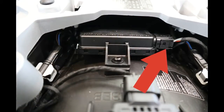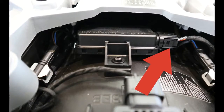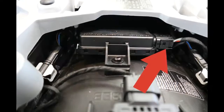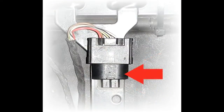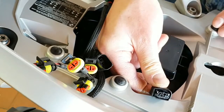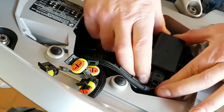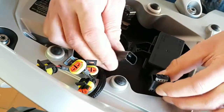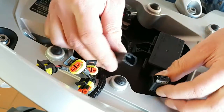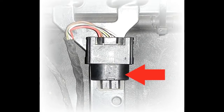If your liquid-cooled R1200 has an RDC system, you will see the RDC module in the small compartment just behind the rear seat and in front of the tail light. Note the wiring harness plug connected to the module. If your R1200 does not have an RDC system, the end of the wiring harness plug will be covered by a plastic blanking plug. Disconnect the wiring harness plug from the RDC module, or remove the plastic blanking plug. If you have an RDC system, connect the female EZ-Can CAN bus terminal to the RDC module, then connect the male EZ-Can CAN bus terminal to the motorcycle wiring harness plug. If you do not have an RDC system, connect the male EZ-Can CAN bus terminal to the motorcycle wiring harness plug, then connect the plastic blanking plug to the female EZ-Can CAN bus terminal.